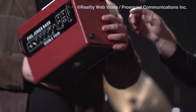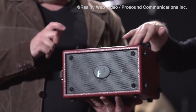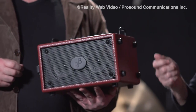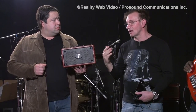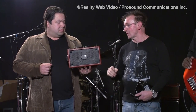It's got the rectangular auxiliary low-frequency radiator on the back. And you'll notice the finish is not like the Tolex vinyl that we often use — this is like a polypropylene bed liner material you see on pickup trucks. It's very tough; you can hit it with a hammer and it doesn't chip. It's impervious to moisture and scuffs. With this size cabinet, we were able to spray it with epoxy paint, get a very hard, resilient finish that lasts for years, while maintaining a really pristine, finessed look.